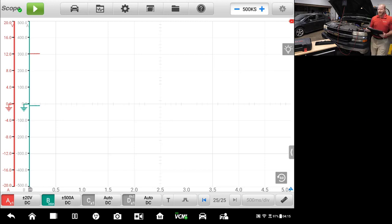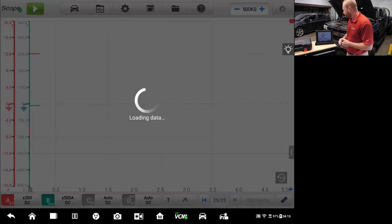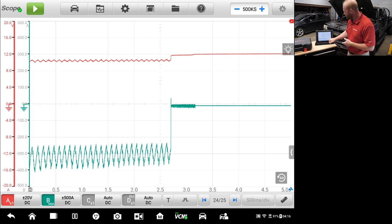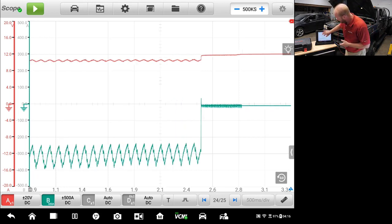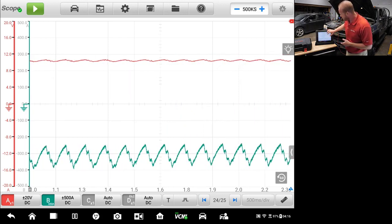You can see our initial amp draw on the screen and the voltage changed a little bit. There we have our pattern. Looking at the bottom of the screen, this is our buffer. If we back up a screen we can see the full pattern — I'll enhance it by pinching to zoom and making it a bit bigger. There's a lot of information built into this screen that we can use to confirm the engine is working mechanically correctly. We can also measure the voltage drop on the battery.